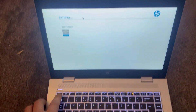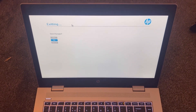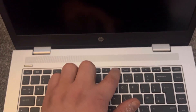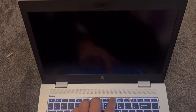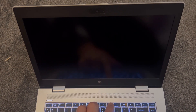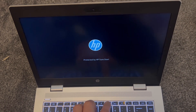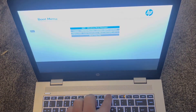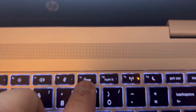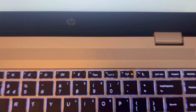I'm going to press the Escape key — I won't save — and the laptop will restart. This time you need to keep tapping the F9 key. By tapping F9 this will bring you into the boot manager or boot menu option. I'm zooming in — F9.